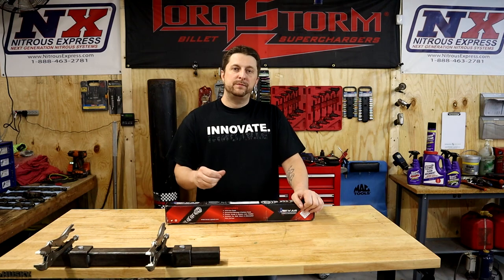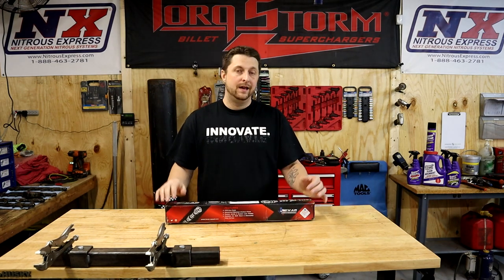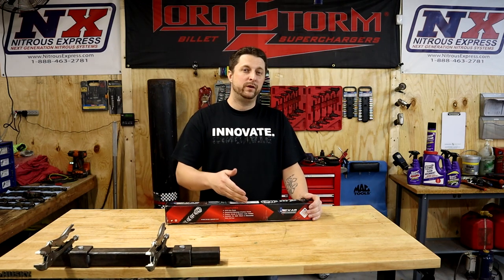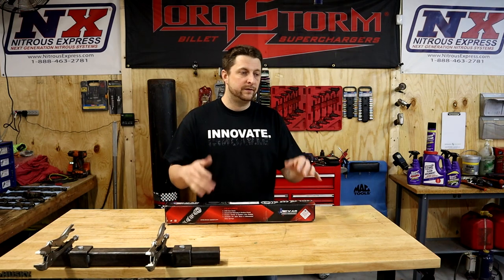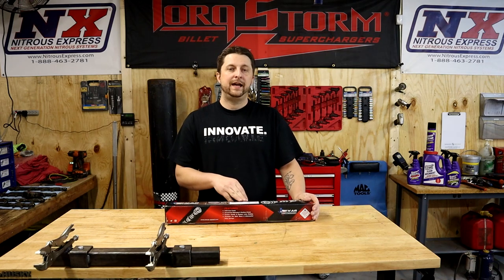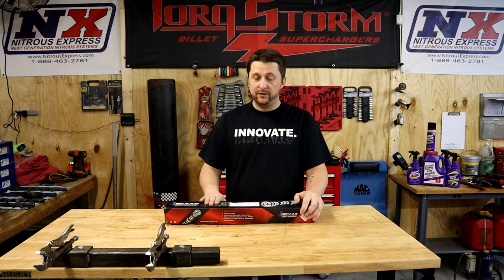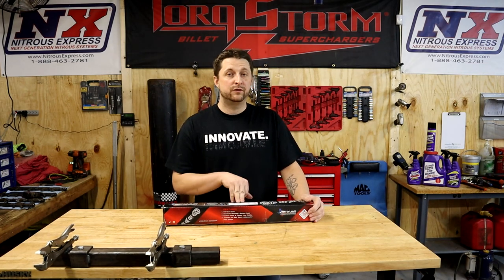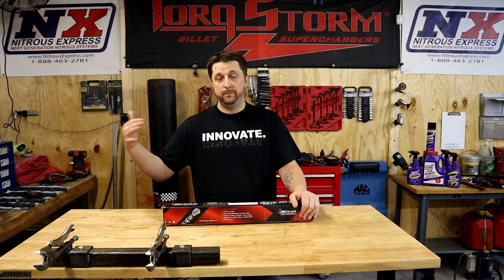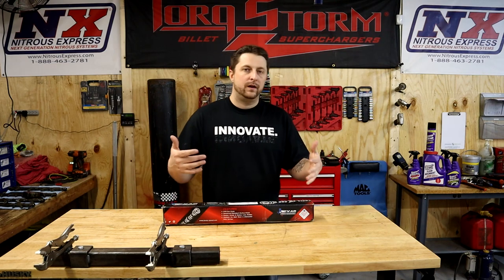J Green rates his cams by stages — stage 0.5, stage 1, 1.5, 2.0, 2.5, and so on. I believe his biggest cams are around the 2.5 to 3.0 range currently. Going off the intake and exhaust numbers on the J Green cams, his biggest cams seem to be around 230 on the exhaust side. This cam is a 230 exhaust, but the intake is pretty big at 224 — specifically for boost. So basically this cam would be somewhere along the lines of a 2.5 or much bigger cam, just trying to give you guys an idea of the size.